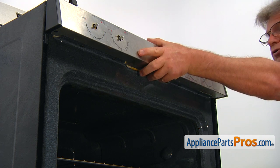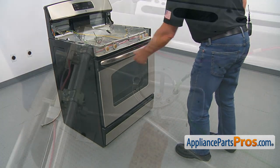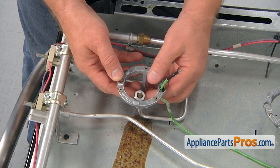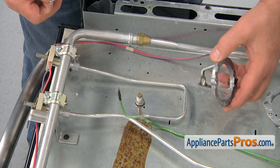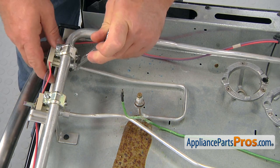Now we're going to pull it off. Close the oven door. Unscrew the mounting nut manually. Lift up the support and pull out the electrode wire. Using the 13 millimeter wrench, unscrew the mounting nut at the manifold and remove the orifice holder.